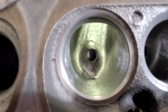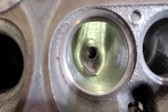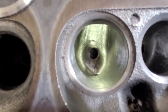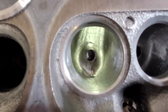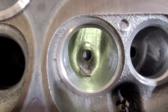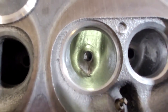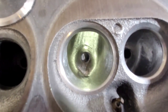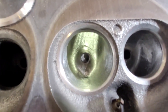On the valve job I just hit the 45 and it was completely concentric, just the way Ford did it. I read in a Ford engine group on Facebook — first thing they say is 'get AFRs.' Well, we're going to do some work on these so-called pieces of junk and they're going to work out really well. I'm aiming for the fences — if I don't make them into sprinklers, these are going to be about the baddest E7s around.